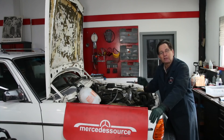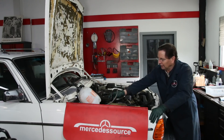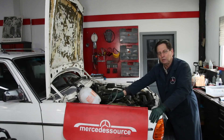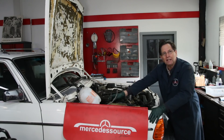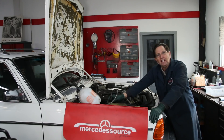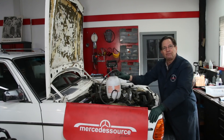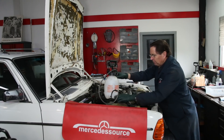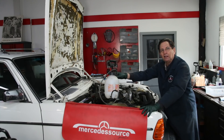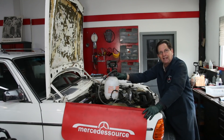Because we have a pressure gauge on our pressure bleeder, all we needed to do is come up with a fitting. This is a commercial fitting that's available. Gerson is in the back room trying to engineer a cap that we can sell to people who already have our tank — they can hook it up to the top of the radiator or to the coolant reservoir and pump up pressure, then check whether they have a leak. You can even test for a blown head gasket, but primarily I found this very helpful.